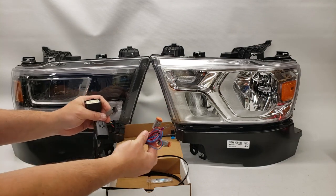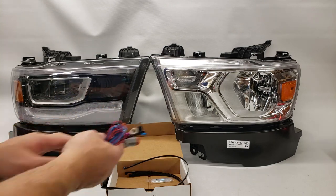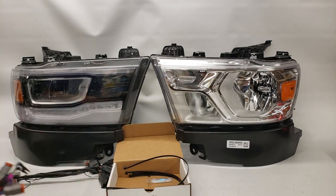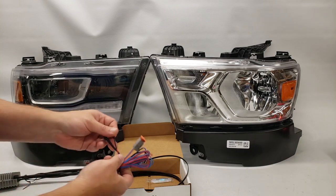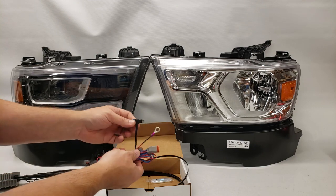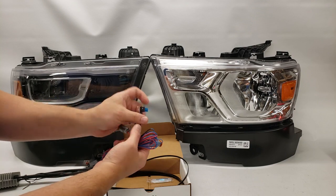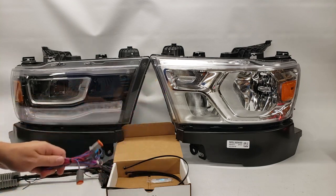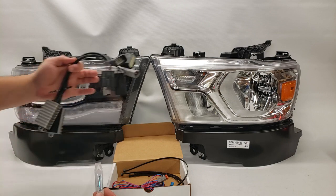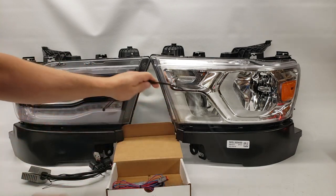This will be a little different from what goes out in the next production round — the first batch had some handmade harnesses, so there will be a slight difference on future production models. The installation is real simple: you have a power eyelet and a fuse tap that goes to the fuse box, which provides power and daytime running light. You'll also get a packet of dielectric grease to put on all the connections to keep corrosion away, and some big zip ties.